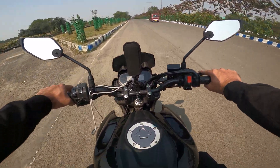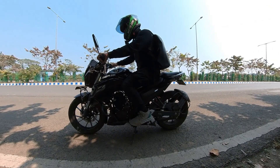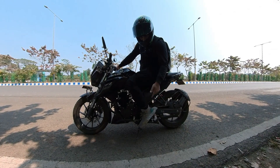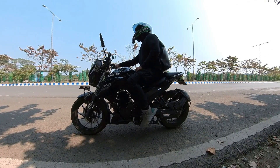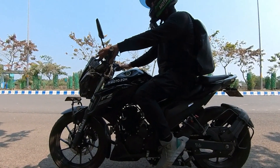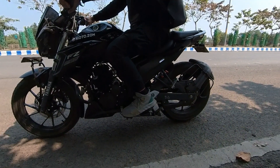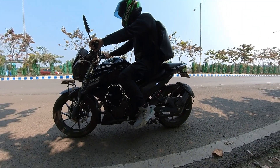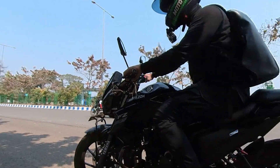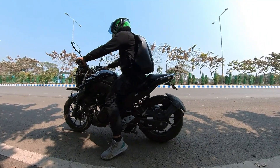If I accelerate slowly, it will move forward. With my 360 camera, I'll demonstrate how to shift down and shift up. Half click up is neutral, as I said. Make sure your feet are always on the pegs. Turn on the ignition, wait for a while, pull in the clutch — the bike has started. Put the bike in first gear, find the friction zone, and then give a little bit of throttle — the bike will move forward. You give the throttle and it will go forward.